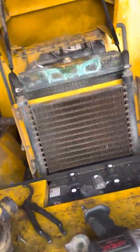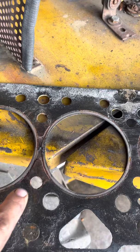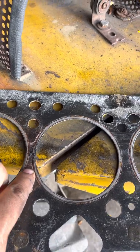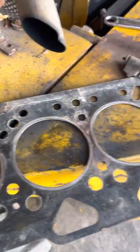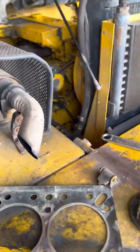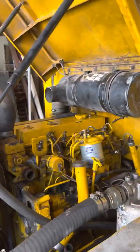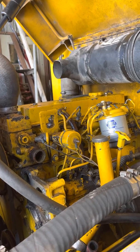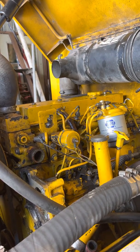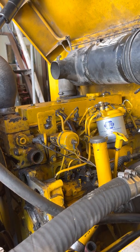After I put it back together, I looked at the old gasket — it looks decent. You can see this spot over here, but I don't think it was a head problem. I'm glad I did it because it was old. I didn't see any watermarks or anything when I pulled it, so I wasn't sure it was a head gasket. I put the head back together, ran it for an hour, and got milky oil all over again.